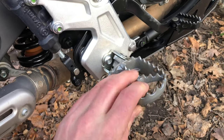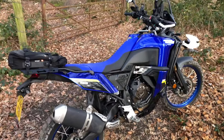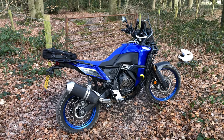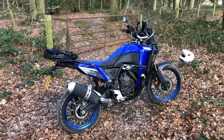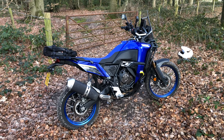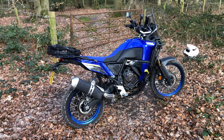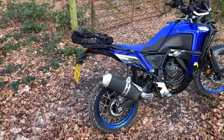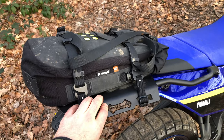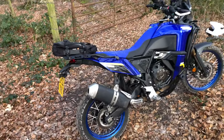Took the inserts out of the foot pegs. One of the biggest and most expensive upgrades I've done is getting the springs changed on the bike - they're a lot heavier and set up for me. I weigh about 95 kg, but Damien who does our suspension set the spring rate a bit firmer for the back, allowing an extra 15 kg, so set up for a 110 kg rider. His theory was that when the bags are on the back there's a lot more weight over the rear end. It rides so much better.